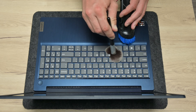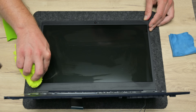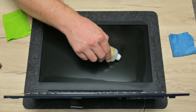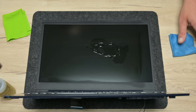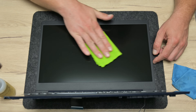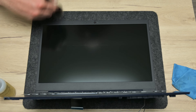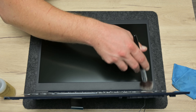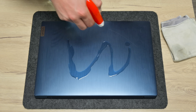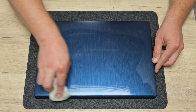After the basic cleaning I took a soft and fluffy napkin with a little bit of anti-static glass cleaner and isopropyl alcohol, and very carefully I start cleaning the keyboard — the keys, around the keys, and the whole palm rest. Again I use vacuum cleaner and brush to collect some leftovers of dust. To clean the display I go again with the same napkin. These fluffy napkins are good for removing dust and dirt in the corners and around the bezel. After the basic cleaning I used isopropyl alcohol mixed with anti-static glass cleaner and soft napkins. Unfortunately in the middle the laptop display has a horizontal scratch — this happens when the display touches the keyboard and is very usual with many laptops. The top side is in perfect condition except for one scratch.